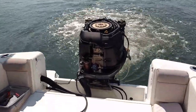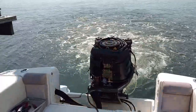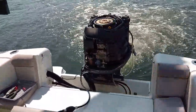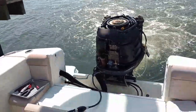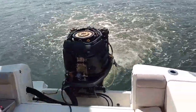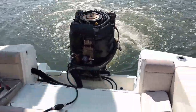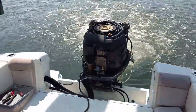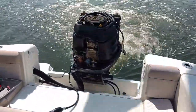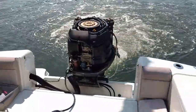I'm going to turn up the RPM just a little bit. That about wraps up our demo and tutorial on how to flush out your fuel system. You can get by without having the MEDS software, but it's a real nice thing to have. If you don't have MEDS software, what you're going to have to do is cycle the key switch on and off about a few dozen times so that you can get the fuel pumps to push clean fuel and try to displace as much of the contaminated stuff as possible. Flush it out through our flush tube and push good stuff in. I'm confident we have pretty good gas in the fuel system on the motor, but there's no substitute for a complete fuel system teardown, which is the first thing on the list as soon as we get this thing trailed. Tyler Holland for Outboard Specialty Tools — feel free to check us out and contact us anytime with any questions.